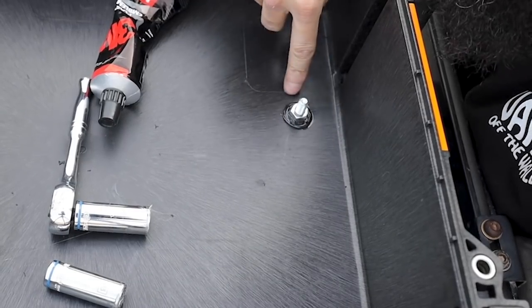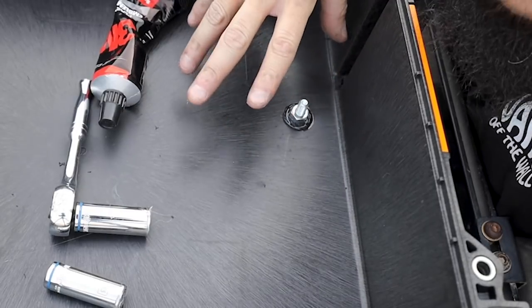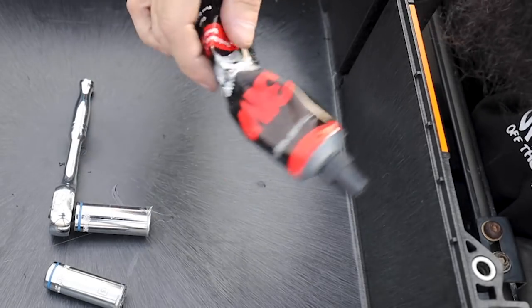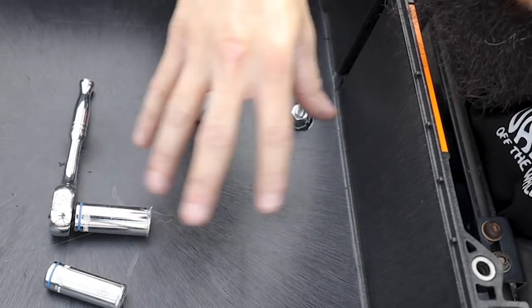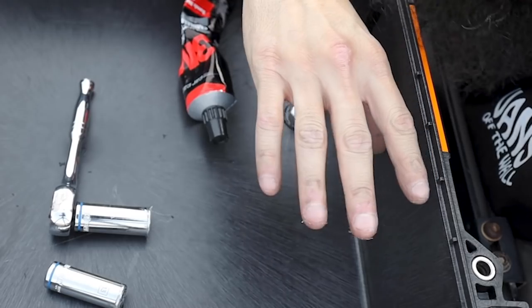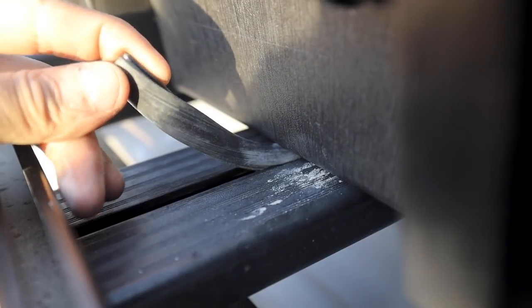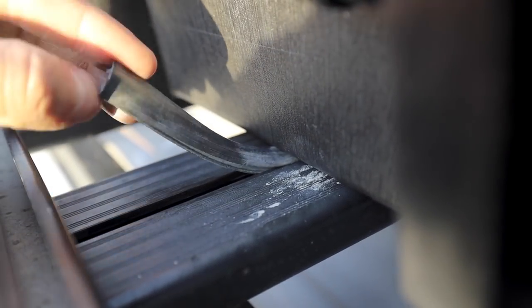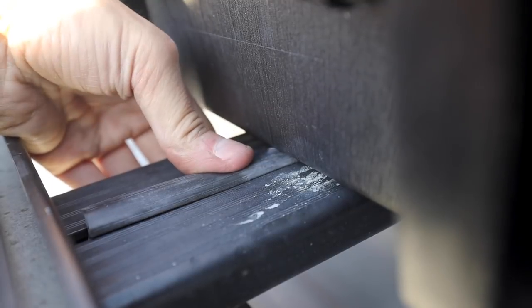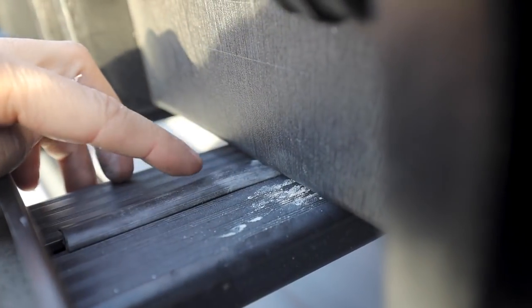This should be the finished product inside. I did use a longer bolt, but it's not really going to matter since everything going in here is recovery gear. I can't stress enough that using sealant will keep everything dustproof and waterproof — especially when you go through different elements, whether it's snow or cruising by the beach. You definitely want to keep this stuff dry. Last but not least, I do recommend you install a weatherstrip like this — Frontrunner has these on their website — and it separates the load bar from whatever accessory you're adding and prevents rattling.